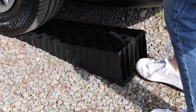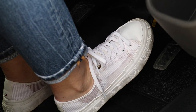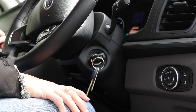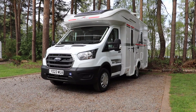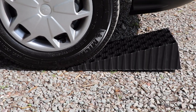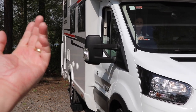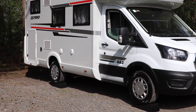Kick the ramps so they tuck slightly under the tyre. The process here is to drive the motorhome to the very top of the ramps, then using the foot brake to control the descent we will roll back until the motorhome is level. Before driving up the ramps, make sure no one is close to the motorhome and that they're well away from the levelling ramps. Using gentle throttle and clutch control, drive the motorhome forward until it's at the top of the ramp. It's useful to have someone to help you spot your position and give signals or call out when you're at the top of the ramps.